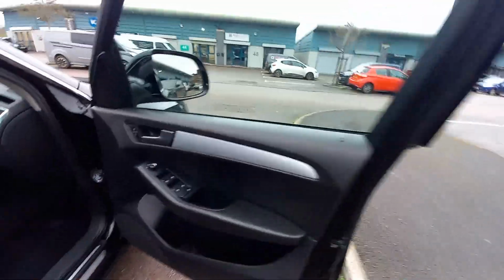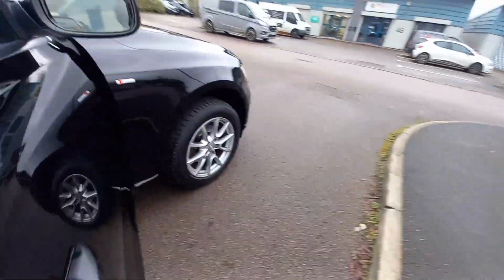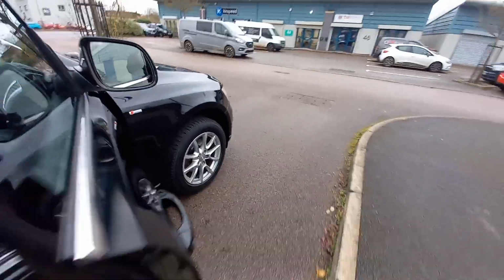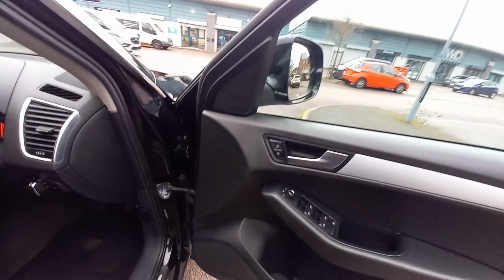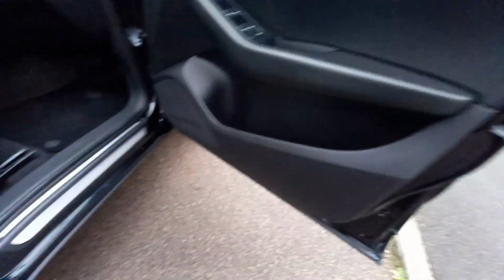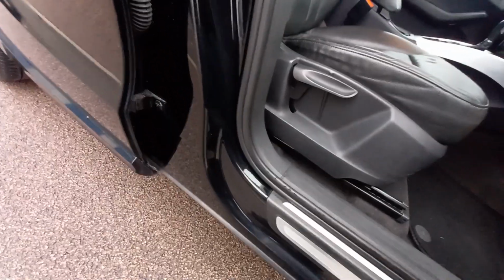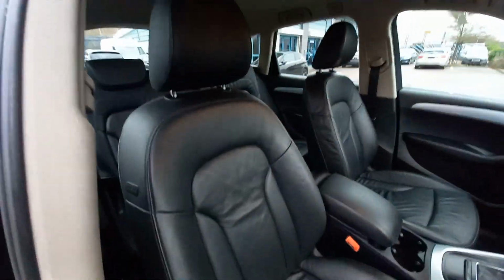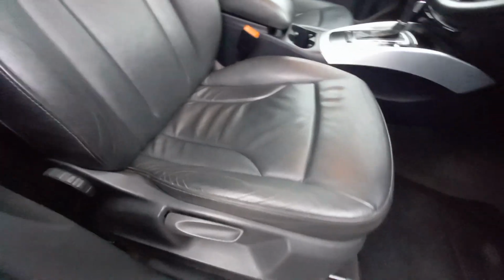And also important, when you have a 4-wheel drive and one of your tyres, say for example you get a puncture in that front tyre and the tyre is half worn, you've got to change a pair of them. You can't just change one. So it's always advisable to change two, because the rolling radius would be different, because the new tyre has got a couple of mil more thickness on, and it has to be the same rolling radius on the same axles. So when you do replace tyres, just make sure you do replace two, especially if the other one is worn. Obviously if one of the other tyres is like new, then replace the new one, that's fine. But if it's half worn, you have to replace it with a like for like.